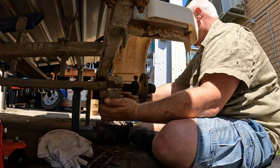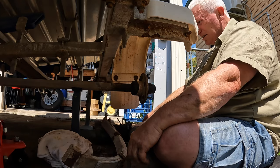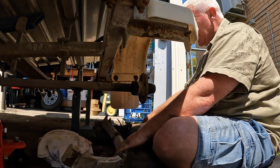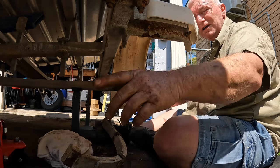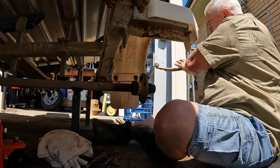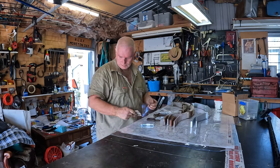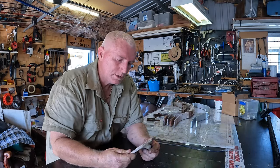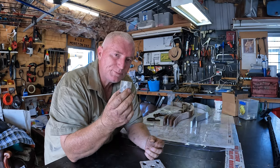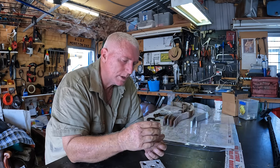That's the bolt. As for stability for the trailer, I've got the stand where I need it so that there's no weight between the stand and spring, and that's holding the axle. Then I've got two more car stands and that's holding the trailer. That's the plate that goes underneath the axle for the U-bolt — I have to clean that up. And that's the spacer that sits between the axle and the spring — I have to clean that up.